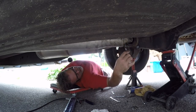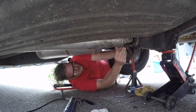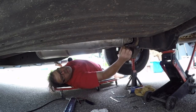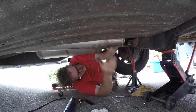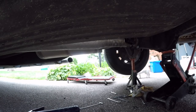Ooh, boys, head rush. And what you're doing is make sure you put some Loctite on the bolt. Just a little bit, not red, just the blue, eh? I didn't do it, because I'm not sure I have to take it back off yet again. When I put her back together the first time, I gave her some Loctite, I did. We'll get her in the middle, and then we'll go put her back apart so I can get some torque on that thing.